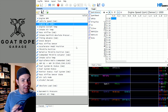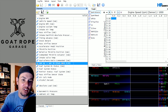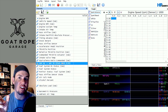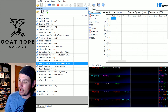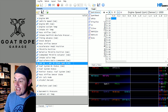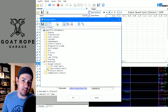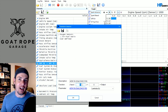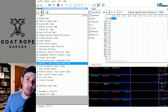Now that we have that out of the way, the other things we can do are transforms. I have a transform on my wideband because if you look at the EQ ratio that comes directly out of the 30-0310, a lot of times it is one decimal point off depending on how many decimals you're showing on your gauge. If you have it set up for two decimal points instead of three, it only brings in two decimal points, so whenever it's supposed to read 1 it reads 10. You can use a transform — go in, choose your parameter under oxygen sensors, equivalent ratio, select it, and then apply math to it. This is also how you can apply scaling math or transform it from lambda to AFR for gasoline.